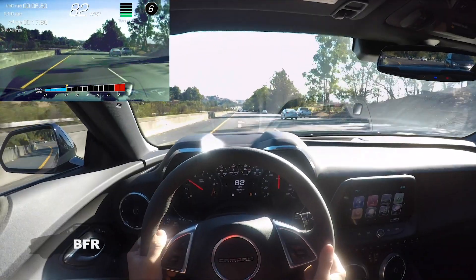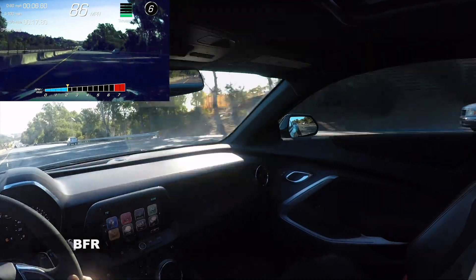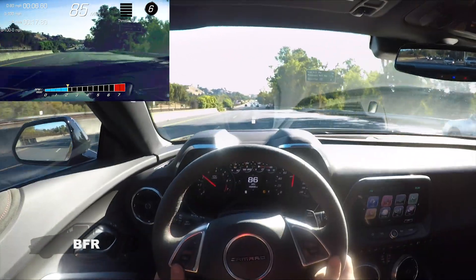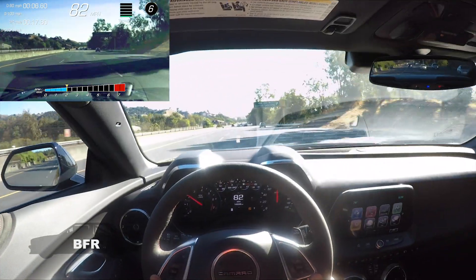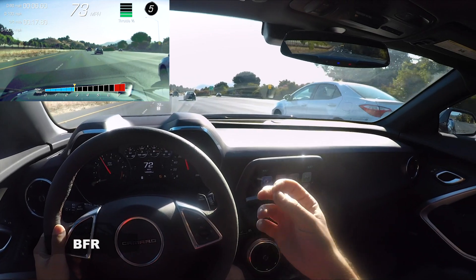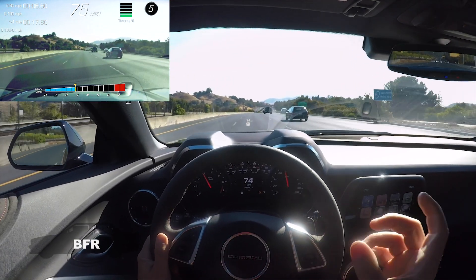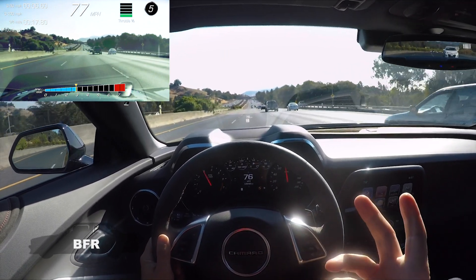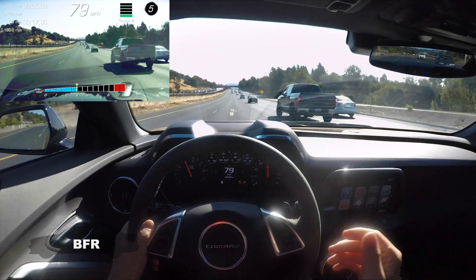The rotors are gigantic — they're 15.5-inch rotors, which is as big as my Fiesta wheels. My E30 wheels are 15-inch, so these are bigger than the wheels on my racing car. It also has an adjustable sway bar in the rear, I believe, with three holes, which goes along with the top hat being adjustable. The rear is fully adjustable for toe and camber. The front camber and toe are adjustable as well — let me know in the comments if the front sway bar is adjustable.